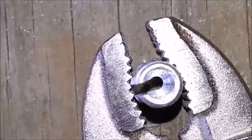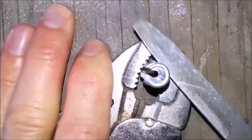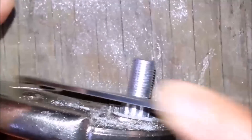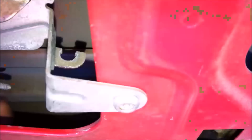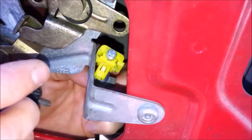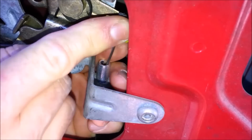On the handle end of the cables for this truck, the handle mechanism won't hit a full-length adjuster, so there's no need to cut the adjuster. Just file a groove around the adjuster so it matches the slot width. This is what the new cable housing end looks like for the handle end of the cables. Press the adjuster into place and insert the cable through the slot. Adjust the cable length and then press the clip through the hole. I cover how to adjust the cable length in the extras video.